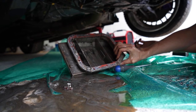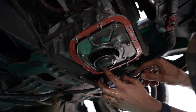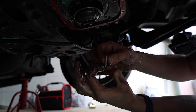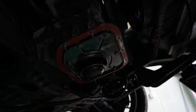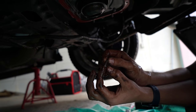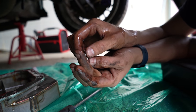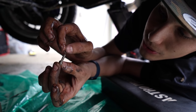Inside the engine looks amazing actually, but wait - what the hell is that? It's a metal piece. That's not a valve stem - that's an oil squirter. That's not good. I found a piece of an oil squirter. That means the piston either wasn't clearanced properly, or this was bent and as the piston came down it smacked the oil squirter and snapped it off. We're going to have to disassemble this engine when it gets back to the shop - we're not going to be drifting this at all.